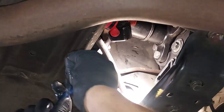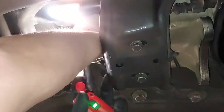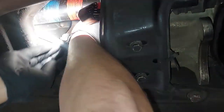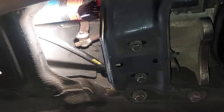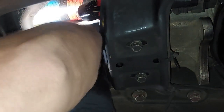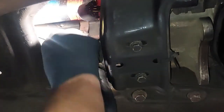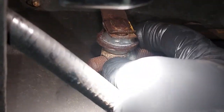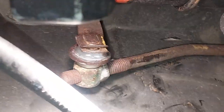There we go. We got that shifter bushing pressed in there. Let's see if I can show you. See, I put a little white lithium grease around it to make sure it was easier to press in there. And there you go. I know my arm is probably blocking you guys from seeing. All right, we have our shifter arm back through there. And then we just have to get our clip over the end. Okay guys, there we have our clip back over the shifter bushing, and see that will no longer rattle around there. It is firm. Now we want to go do the one on the front.